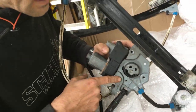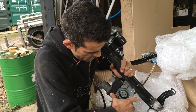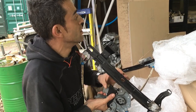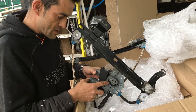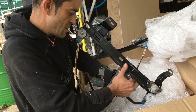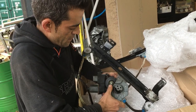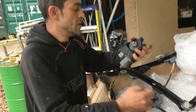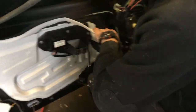I've got the three Torx T25 out. The idea here is to stabilize your motor and actually pry it out of its housing spot, and that's exactly what I had to do on the inside of that door. It does work if you get a little flat screwdriver in at the same time, just to release it. Simply three little T25 screws - now it's off to the difficult spot to try to get this in at the back of the actual regulator.